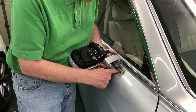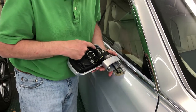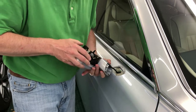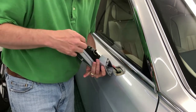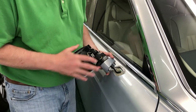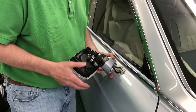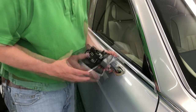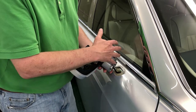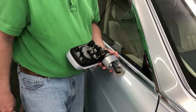Now take a look at this. You can see here is the wire coming from inside the door, all the way through the mirror, around here, curling around, going around this, and burying itself up in the mirror mechanism somewhere. So it's pretty much impossible to take apart this mirror, because you've got to run this black item through the bolt. So the proper way to do this is to open up the door, remove the door panel, and disconnect the wiring from inside the door panel.